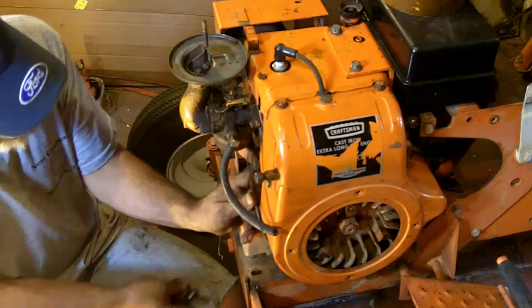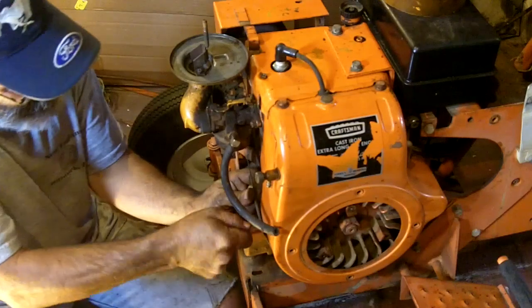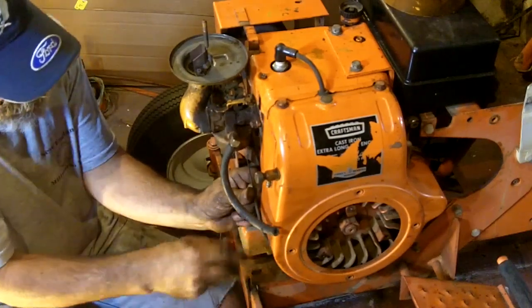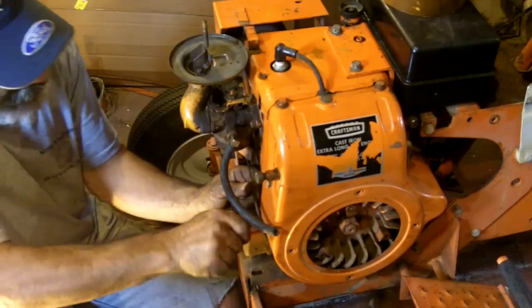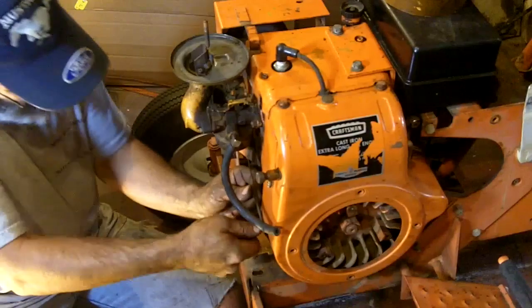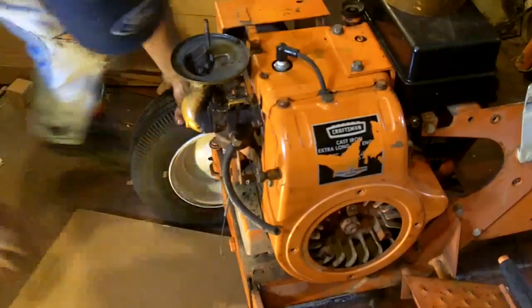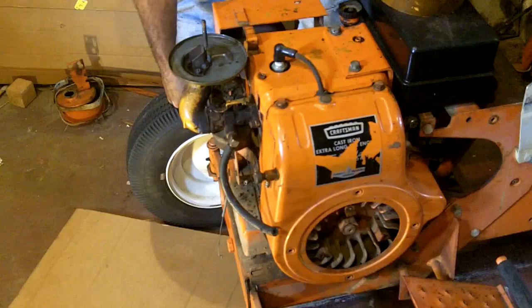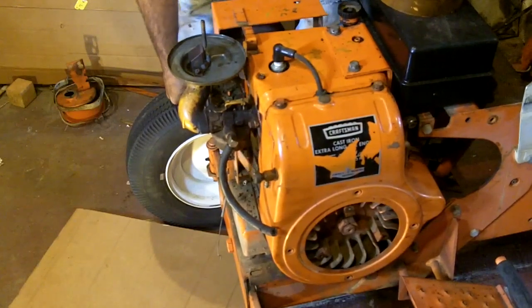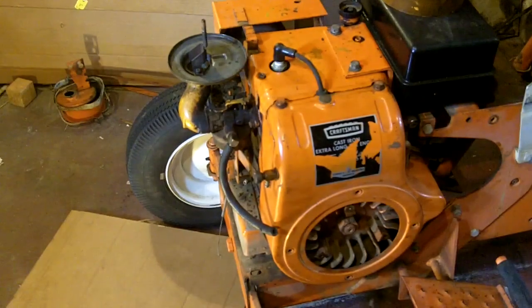So now we're at the idle screw. Oop, and I keep moving it. Bottom it out, and then tighten it up. Hopefully that's going to tighten up enough and not have to be taken back off and reshaped. Now if I move that throttle cable, the throttle adjustment, oh perfect. Can you see that? Can you? Not really, huh? Let's bring you over here where you can actually see that.